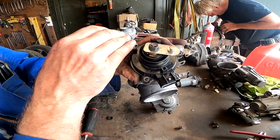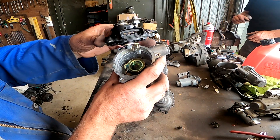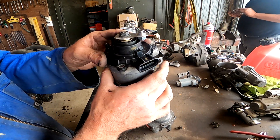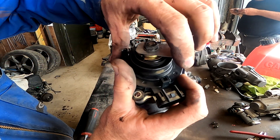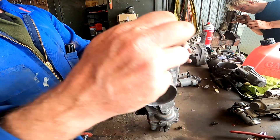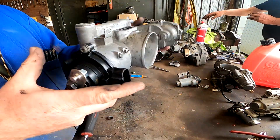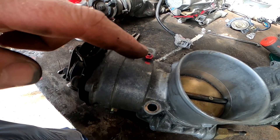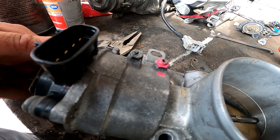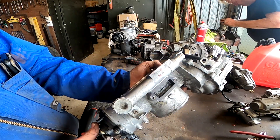I had it pulling in the wrong spot, so I have to make sure that this lever here touches on the flat surface and then it pulls in the right place. I've marked this one up — this is now the idle throttle stop on this setup, so it can give it its base idle. Another one done, ready to go out.